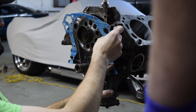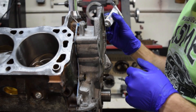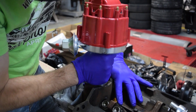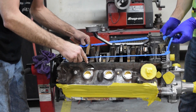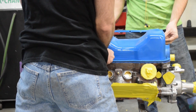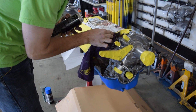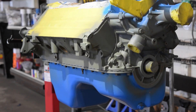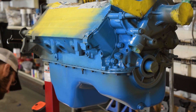The timing cover gasket is sealed on both sides, timing cover goes on, water pump gasket goes on the timing cover also sealed, and water pump goes on. The distributor comes out again and we begin taping off everything. The oil gasket goes on and is sealed in its correct spots, oil bracers go on, all bolts tightened down and torqued to spec. More tape, clean the surfaces with brake cleaner, using self-etching primer on the engine — and then look at that: Ford blue. This 1993 engine is starting to look period now. Painting is always that moment in a build where you know things are really coming together.